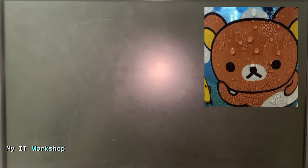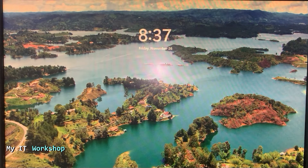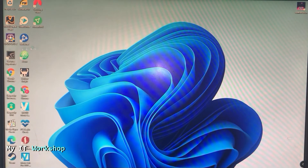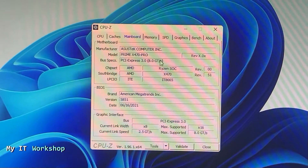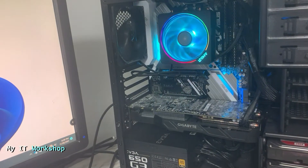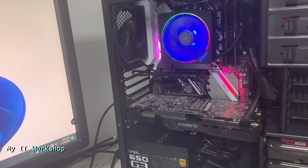Allow me a few seconds to adjust my camera and we're going to turn it on. This is the part where you're sweating because you don't know if it works — but the ASUS logo appeared, then the Windows login screen. I logged in and it's the same desktop. I opened CPU-Z and you can see it's exactly the same computer with no problems. That's how you replace your power supply — whether you want to upgrade, need more power, or if the original one failed.